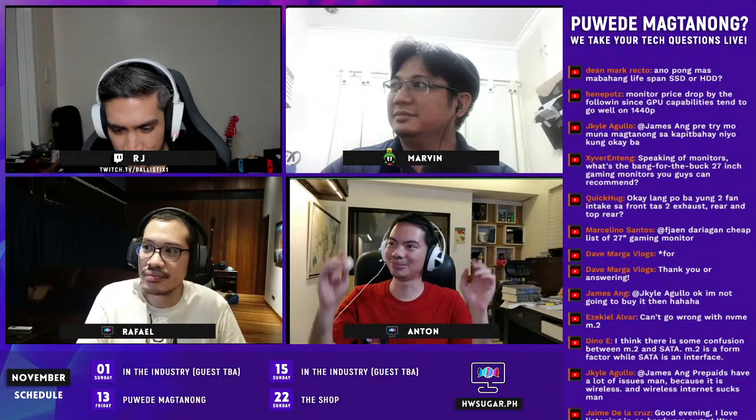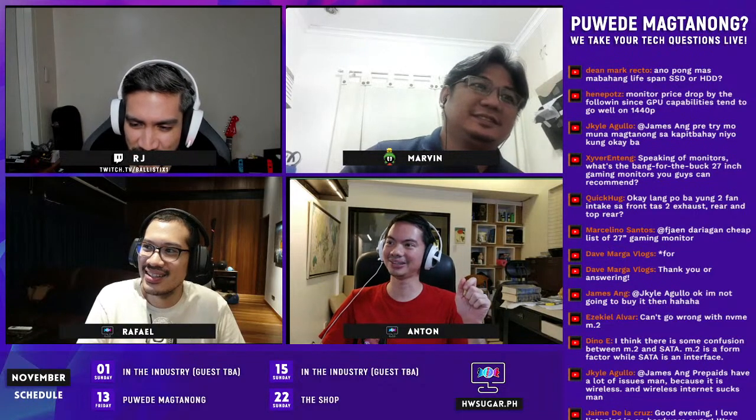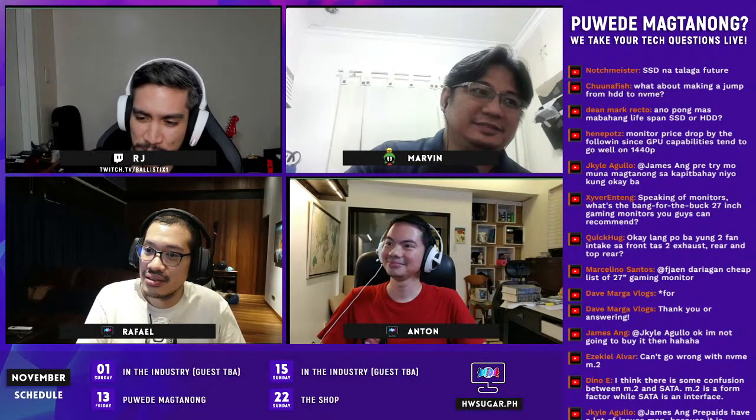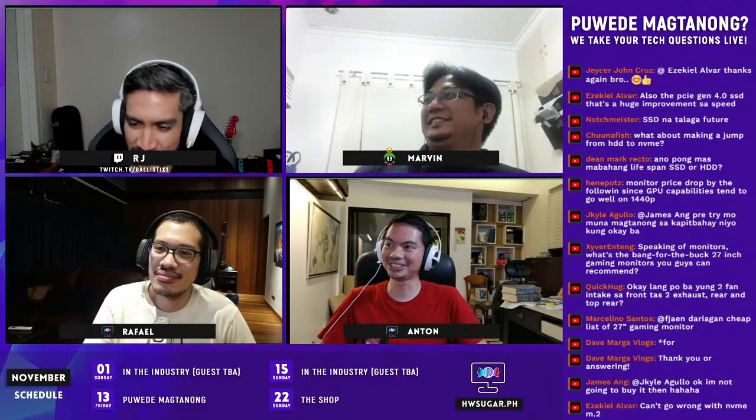Right. And going back to Marvin's point, yung M.2, paminsan the mobo manufacturers like putting the armor, they call it armor, but it's just like another layer. You can't access it right away or unscrew the M.2 right away. Yeah, you gotta remove the armor and then unscrew the M.2. Assuming na hindi naka-block yung GPU or some other thing. Depending on the configuration, standard, it's behind the GPU. So that's two layers that you gotta get through. You think it'd be easy, it's just like RAM, sana plug and play lang dapat yun. But the way it's set up now, it's really stuck in there.